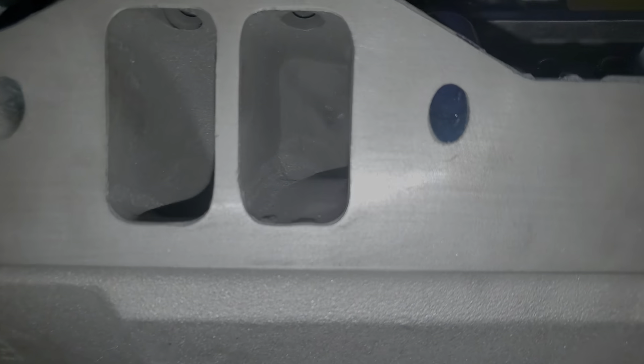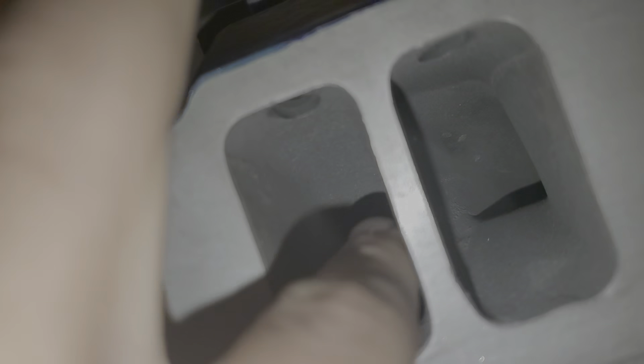Anyway, yeah, these are the ports — anything could use a polish, and everybody's standards are different on polishing. But let me turn my flashlight on — it's pretty smooth, man. This is a good quality intake. You normally don't see intakes like this. Here are the fuel injectors; see how they spray right into the top of the heads? That's for really good atomization. The stock injectors come in up in the corner area and spray straight down — see how these spray at an angle, facing toward the head.